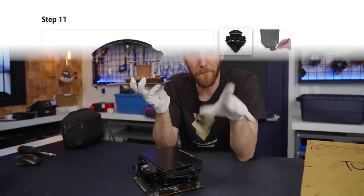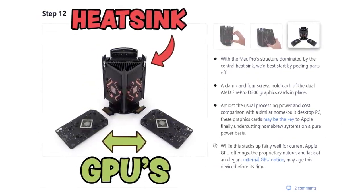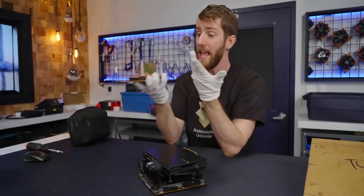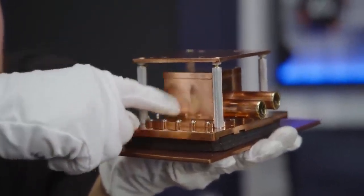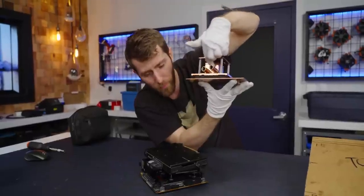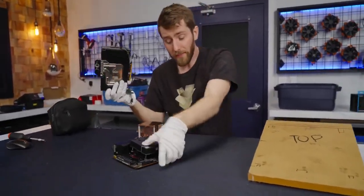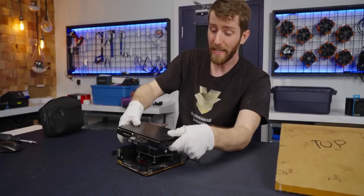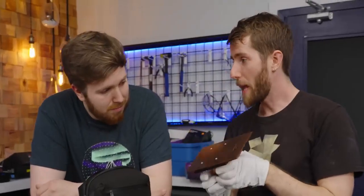But this is also a little bit misleading. Some of the inspiration for this clearly came from the 2013 Mac Pro, which used a single heatsink with multiple heat-generating components attached to its various sides. In much the same way, we have a single water block right in the middle here that is going to be responsible for cooling both the GPU with this cold plate and the CPU with this one over here. While this obviously takes up a little bit less space, unless you get special blocks with fittings coming out the side, it would not actually be possible to build something quite as low profile, although such blocks do in fact exist.